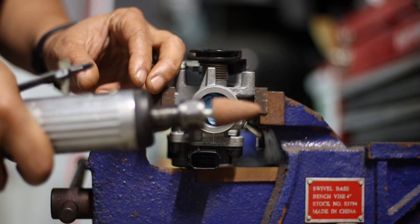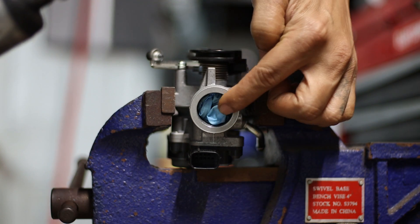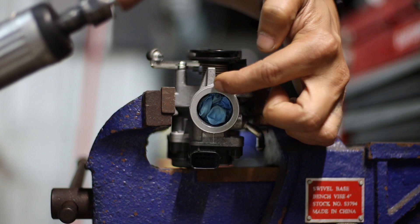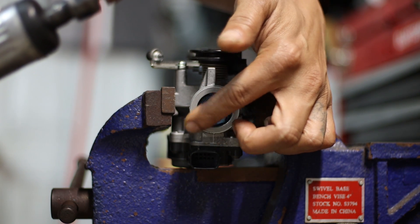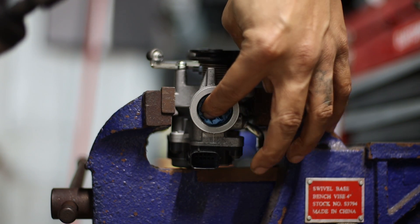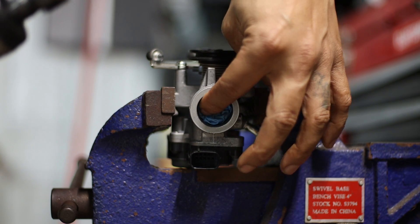For this part, we're going to go ahead and use the air grinder with this cone piece. The idea is to bevel this edge on the inside so that when the air flows in, it doesn't have turbulence running into this flat spot. I don't know how much I'm going to bevel. I shoved a rubber glove in here right now so that I can keep bits from flying on the inside.